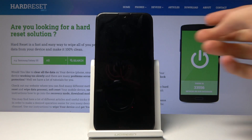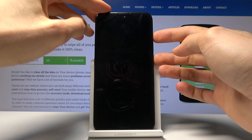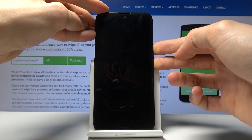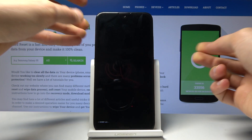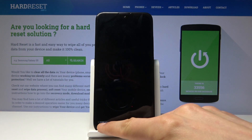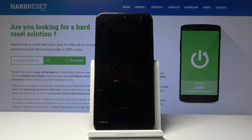Now when it has, you want to hold the power key and volume up — or actually no, volume down, my bad. So power key, volume down. And you can see immediately after you feel a vibration, you'll also see the message right here: fastboot mode. So the device is now in the desired mode.